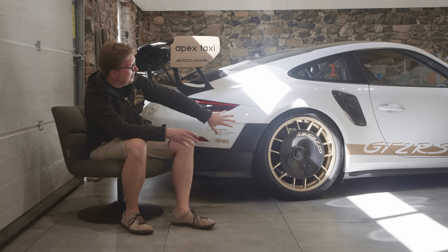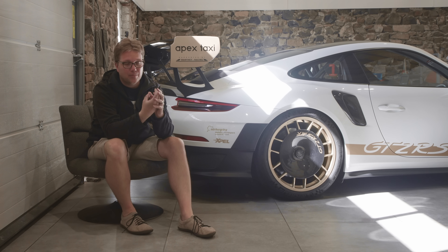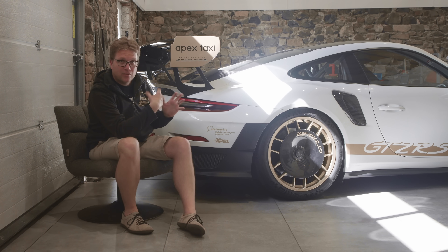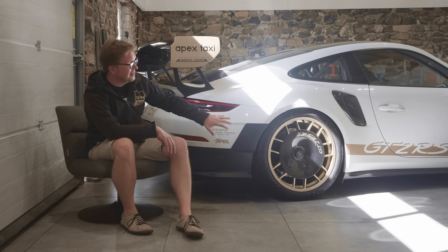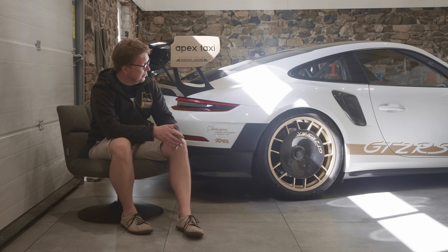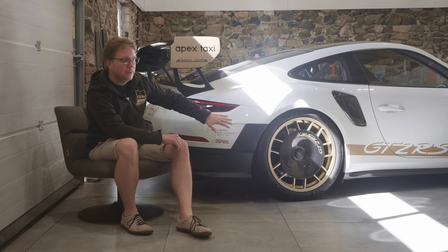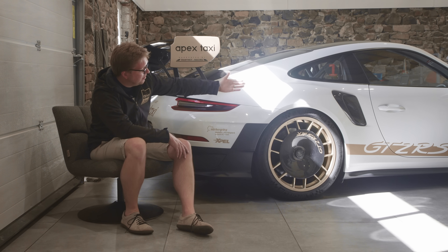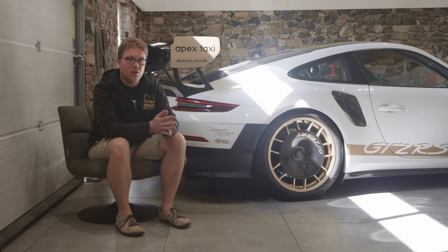You have the rear wheel of this car and you have your brake discs in there. You've got vanes in the brake disc — air is coming into the brake disc and shooting out. You've got obviously the motion of the wheel rotating and that's creating a great force of air as it rotates around. What these wheel discs do is nothing more than manage the air that's coming through the wheels and around the car. You could imagine that if you've got these wheels spinning, it could act as a fan blade, and this disc minimizes the effect of the wheels on the air traveling around the car and coming up into the wheelhouse. You can simply look at it as air management — that's all that wheel disc is doing.